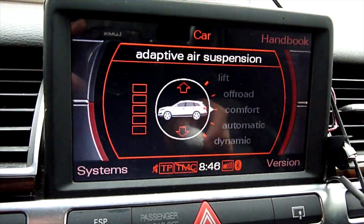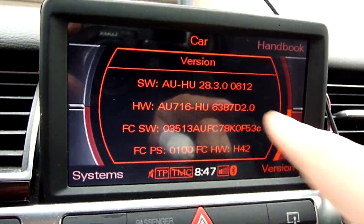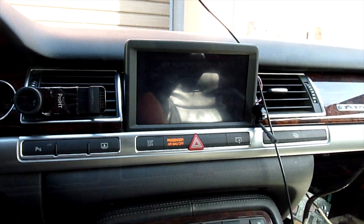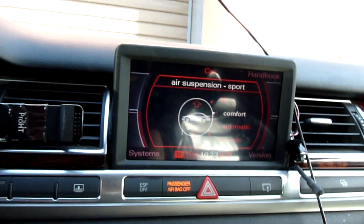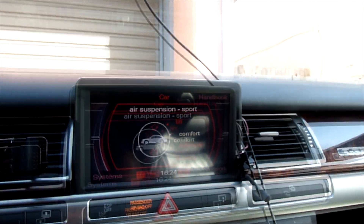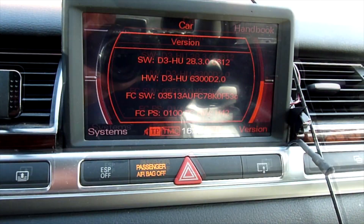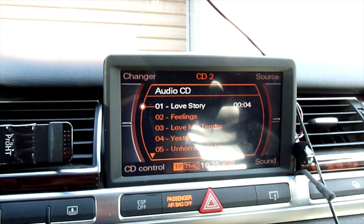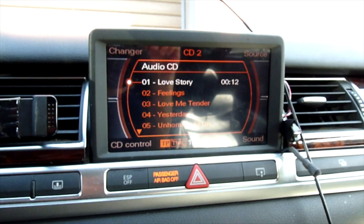You see the Q7 there? That's not an A8. Even if we fix the sound to work, we still have to return it — this is European. The software is 28, the CD doesn't work either. I loaded my A8 EEPROM into the EEPROM of the Q7. Even though VCDS will say component protection, after I recode all the modules the sound came back. But this one is European, so the sound originally didn't work.